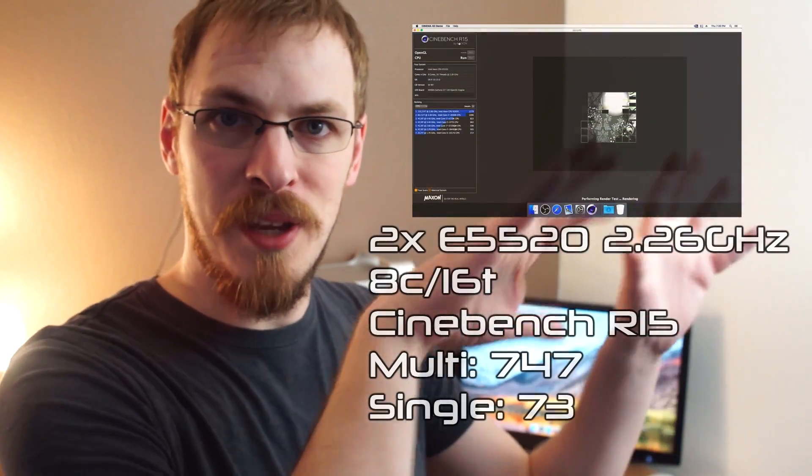This is now Saturday morning. Remember how I mentioned you need to be really careful about the tension on the top of the heatsink as you're screwing those down? That's exactly what bit me. The firmware was fine, everything was still fine as far as software and hardware goes, and I didn't bend any pins — but my pressure down on the CPU wasn't level across the top of it, and I think it ended up lifting the CPU on one side. After fiddling with the tension, I managed to get it to POST. We now have 12 cores and 64 gigs of RAM fully working, as well as the 1050 Ti.